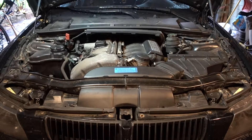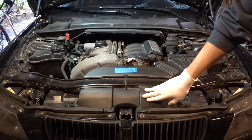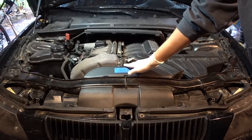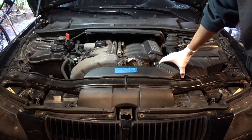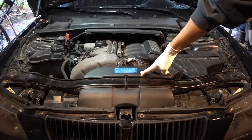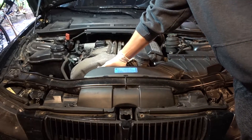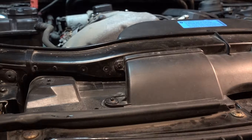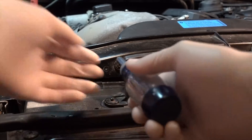The replacement is pretty simple. We're going to start up at the front here — we're just going to unscrew these two bolts so we can get the snorkel off. This is kind of a pain just because of this little connection right here, but overall it's pretty easy. This is going to allow us access into the engine down here to take out the solenoids and replace them. We're going to be using a T20 Torx on a normal screwdriver.